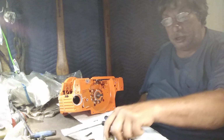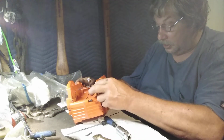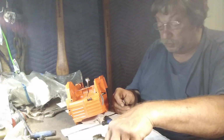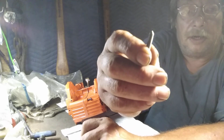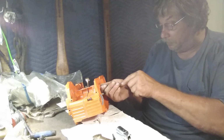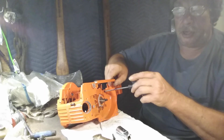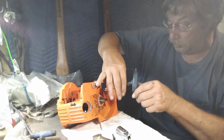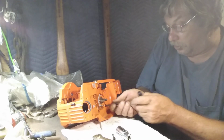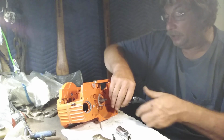Oh, geez, you know what we need to do? We have got to get some bolts in. 6 case bolts. See the taper on them? That's the factory case bolts. Once in a while, you'll get an oddball. These little T-wrenches, I'm going to tell you right now, they help you like you don't know. You just touch. Don't get carried away. Bring it up where they just touch. We had a nice soft gasket.